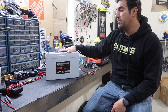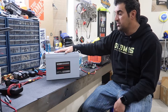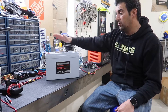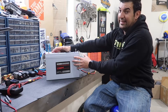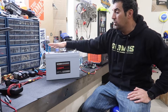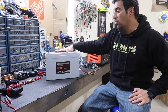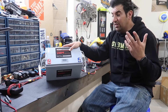What this tells me is: if you have one of these in your toy hauler and you're setting the cutoff to 11.5, you're going to get about 85 amp hours out of it. If you have two, obviously you'll double it. When you see that 100 amp hour rating, at the 11.5-volt cutoff you're really talking 85 amp hours.